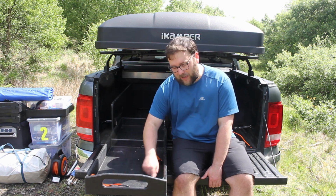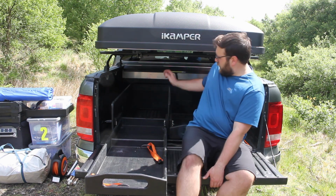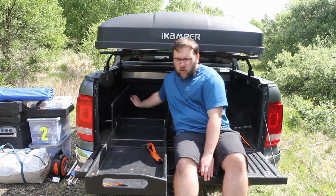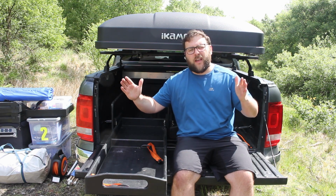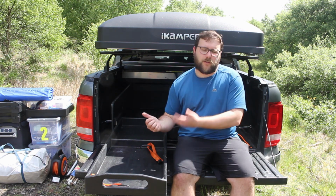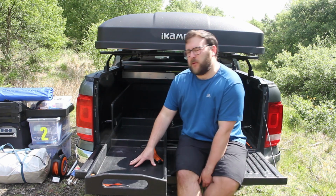I am thinking about putting a big cutout in here, again just to save weight under the fridge. The same on this central divider of lane 1 and lane 2 to save weight, because I did it under the drawers and it took out a big chunk of ply, 18mm thick, probably about that much. Either way, on both lanes, it's a weight saving worth having. It makes it easier to get the drawers in and out as well, because you can just lift them onto your shoulder.